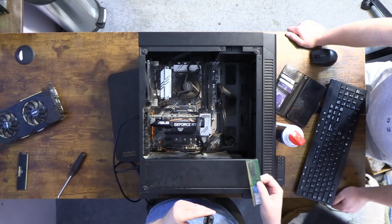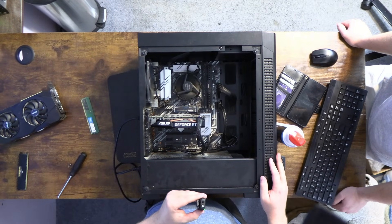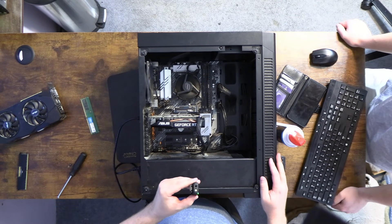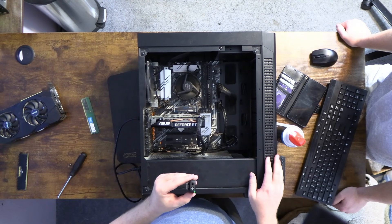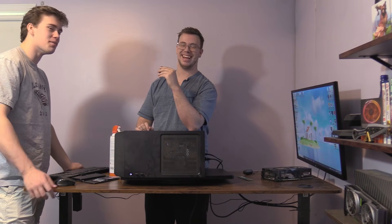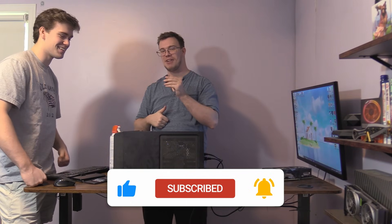That's why you're running into issues — you're in single channel, so it's overloading that RAM slot, causing it to heat up really hot, which killed it over time. You're gonna have to get a new GPU and a new board plus some other stuff. You might want to just upgrade your PC altogether — you're gonna run into gaming limitations no matter what. His response: 'This sucks, but it's been like seven or eight years, so I guess it's done its job.' Does anyone want to sponsor the next video for his PC build? G man out!